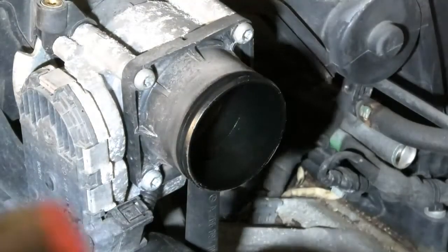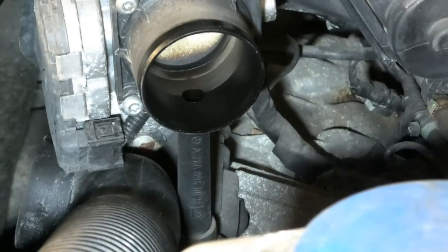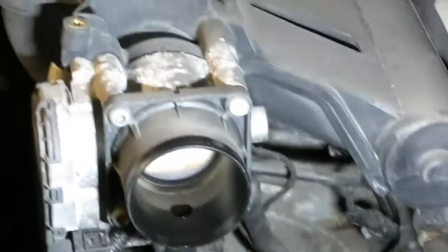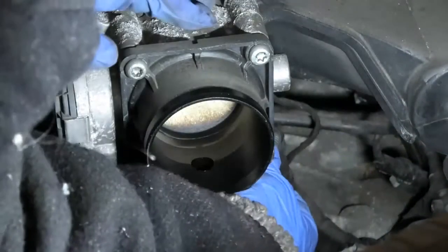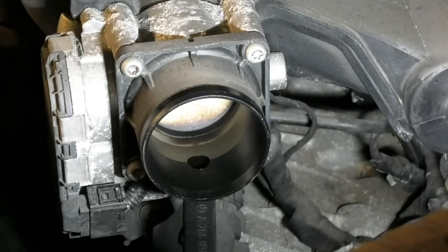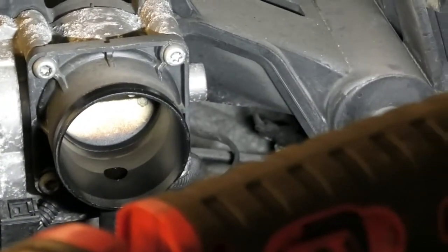So that's giving us access, and I don't think that throttle body was ever cleaned. And it does have, as I can see already, some carbon build-up there, which can cause this issue - this intermittent issue regarding the reading of the manifold pressure sensor. So it's going to be a matter of opening that throttle body and trying to clean it.